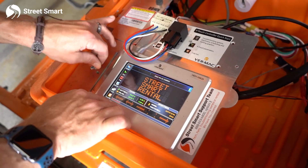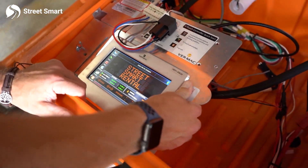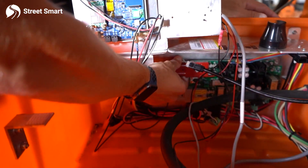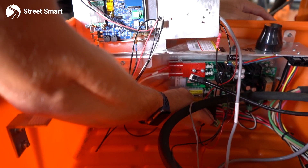On these Pro Series, it's right here inside the battery box. You'll take this screw out and pop this box off. You'll be able to see your red plug and your gray plug. On the gray plug, you'll see it says 'disconnect last, reconnect first.'